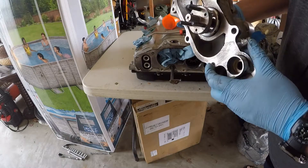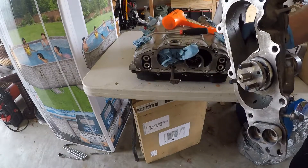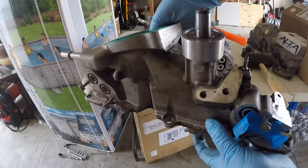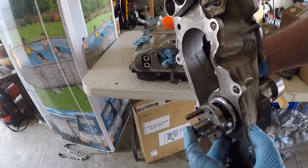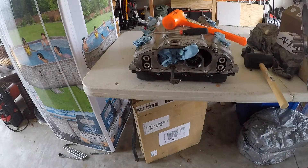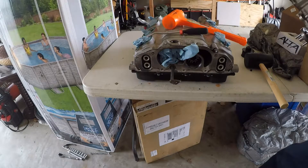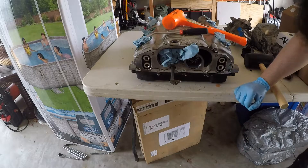Now the easy part — as you can see here is the shaft. It's got the sealed bearing inside there; that's the one on the outside. What we're going to do is put that in the press and push against this to make it as straight as possible, so we don't put any lateral forces on these bearings. You can see how the butterfly rod just stayed there. It sounds a lot easier than it looked in some of the other videos.